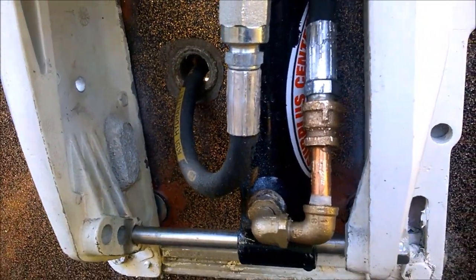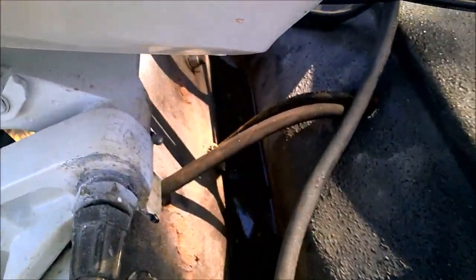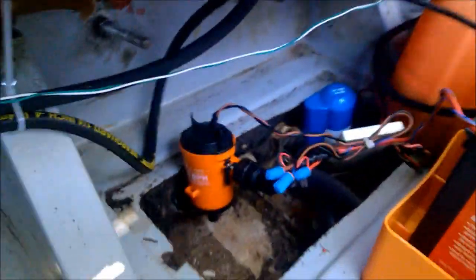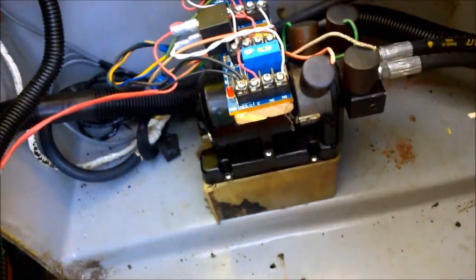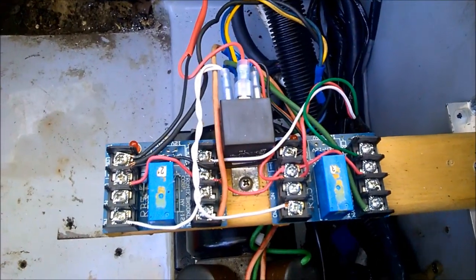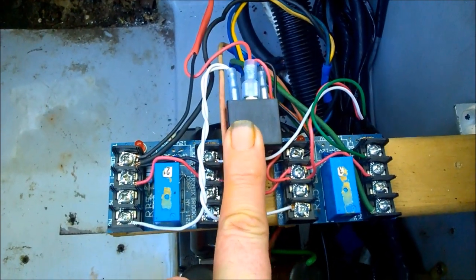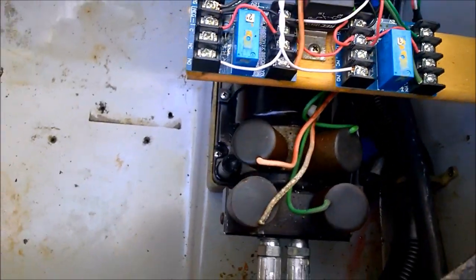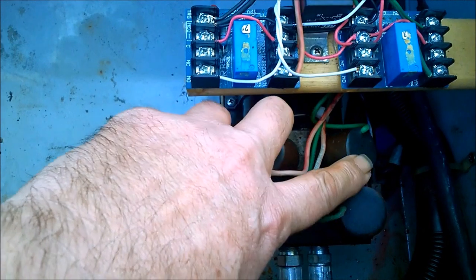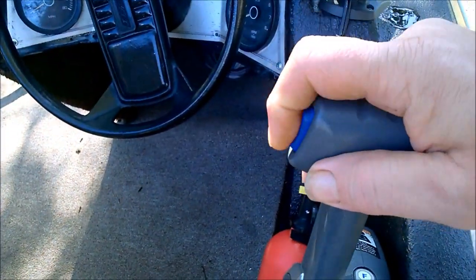That fancy plumbing job there has a couple of reasons for that. The hydraulic cables come through the hole and go in here and over to that pump, which is a used Bennett tab pump that I had laying around. A couple of control relays — this is your up relay, your down relay, and your motor relay — because this thing draws 20 amps, so there was no way it was going to switch off the trim tilt switch. It's got double valving and heavy-duty hydraulic lines running right into the thing. It works directly off the trim tilt switch as intended.